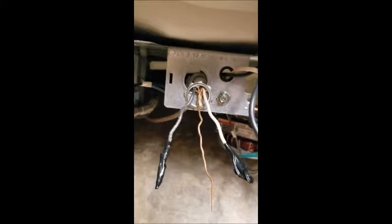So anyway, just a quick recap. Old dishwasher, new dishwasher in the box, can't really see it. So I'm going to feed these wires. This is what's coming from the circuit breaker. I'm going to disconnect those. Well, I disconnected them. I'm going to feed them out of here. Then I'm going to disconnect the drain line, and then I'm going to pull the old one out. And then we're going to start to get the new one put together. So stand by for possible electrocution.